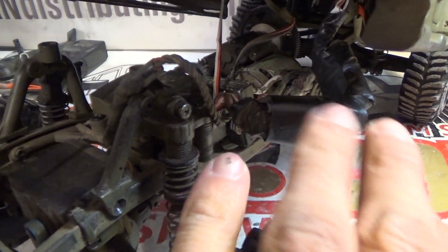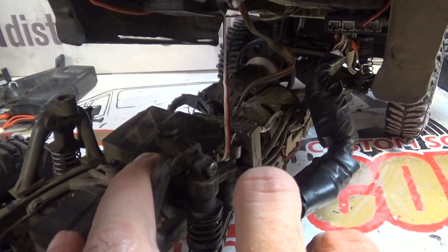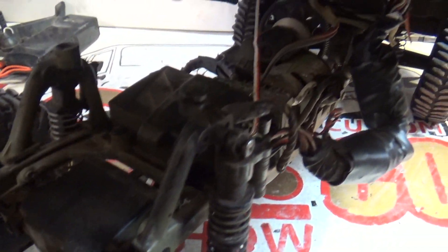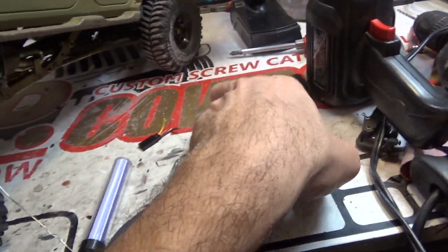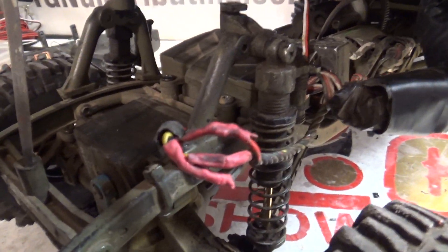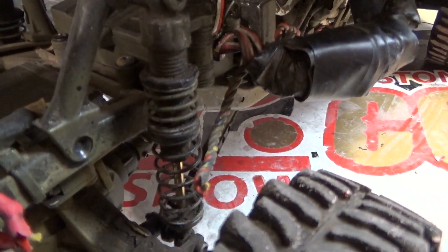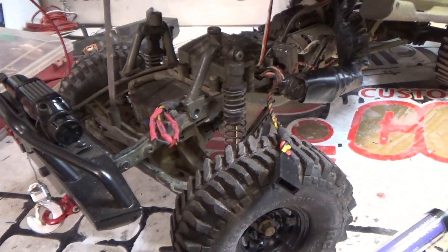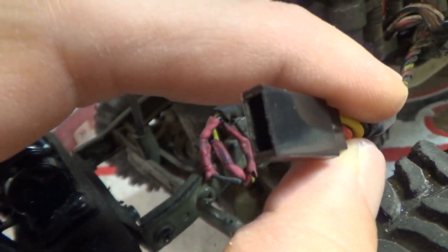This wiring right here is a great example of what not to have — it's a wiring mess, a nightmare, from back when I didn't really care too much. I care a lot more now, so don't do that if you can get away with it. All right, next step — we're going to cut this old nasty heat shrink right here. Always disconnect your battery before doing this. Now I'll get those wires spliced, tinned, and ready, then attach the lead, pull the old servo out, and put the new one in.